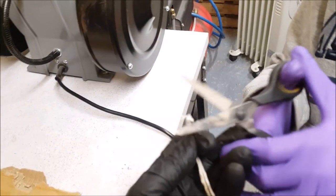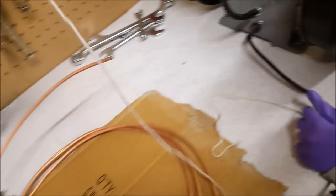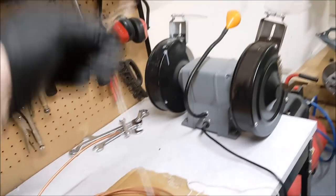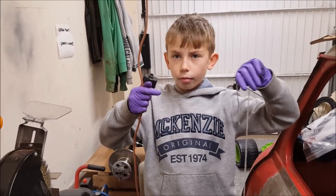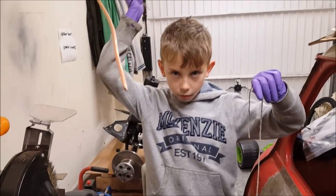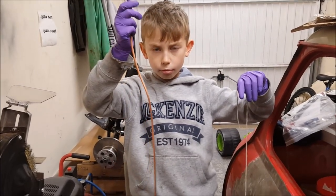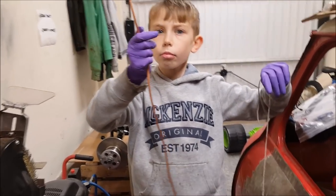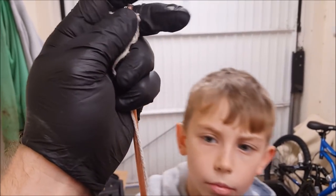This old one is just rubbish, we need new ones. So there you go, we've got the string as a template. Right, so we've got our length of string we need, and we've unrolled the brake pipe out, I was going to say as straight a line as I can, but that'll do. Now we need to measure the exact length, so we're going to hold the string against the brake pipe. It's not going to matter if it's slightly off